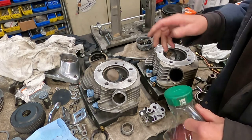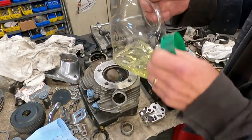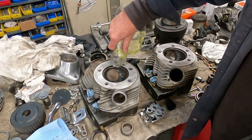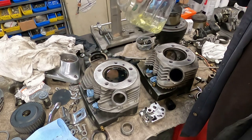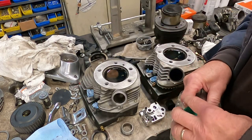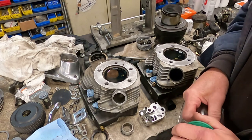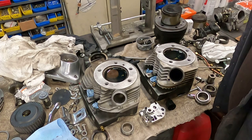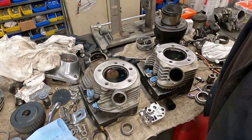We're just going to do a simple little test. What I've done is put the spark plugs in. If you want to find out whether your valves are leaking, I'm using some diesel that I had in the shop — you fill that up over the top of the valves. I'm using diesel because I have some. Then you let it sit, and if you come back and it's gone, then the valves aren't seated. That's about as simple as it gets. I'll come back here in a little bit and we'll see where it's at.